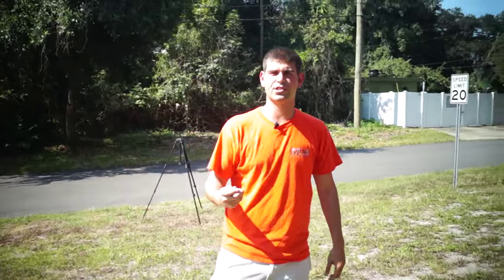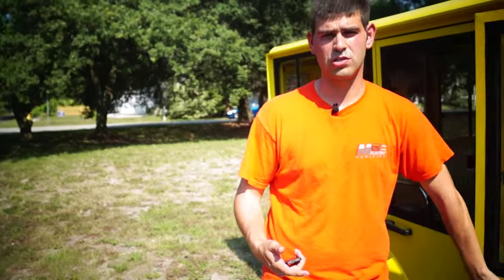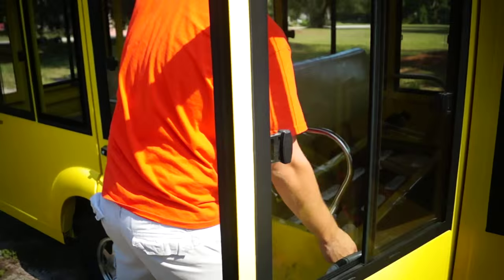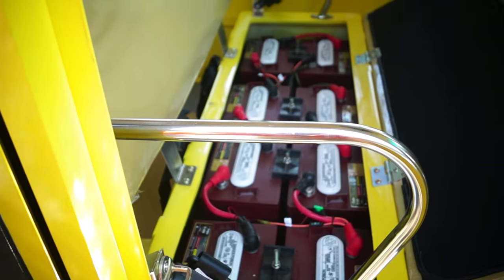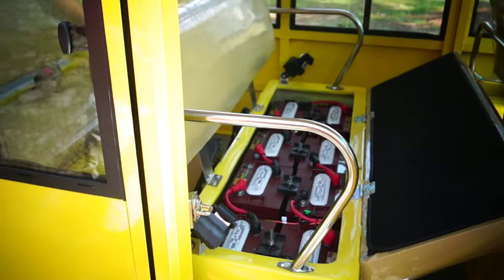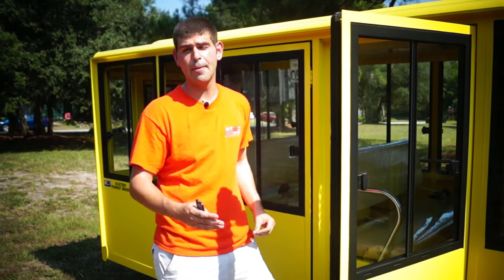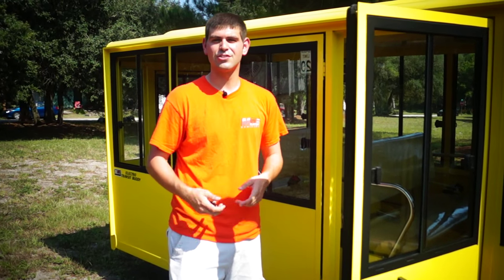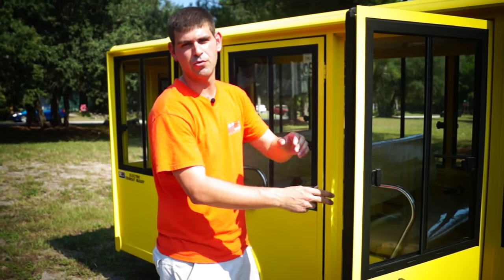All of our electric shuttles are produced right here in Atlantic Beach, Florida — batteries, controllers, chargers, everything is assembled here in America, and we give you one of the largest warranties in the nation. Flipping open this seat, you can see the battery packs: four total in the back and eight underneath the second row — these are all Trojan T105 batteries. If you need a bigger battery to go further, we have them. A really nice thing our shop does is label all the wires for accessories like heaters or air blowers, so if a fuse blows down the road, you know exactly what it goes to.